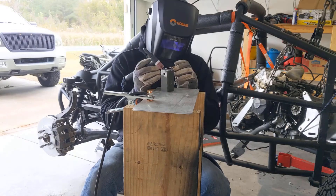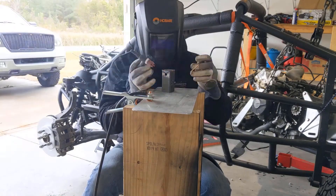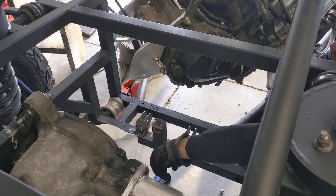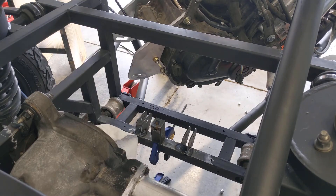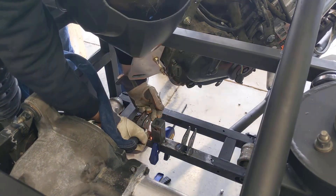While we've got the engine a little bit out of the way, one of the other things we're also going to throw in here is this other piece of tubing with a hole through it — that's going to serve as the mount for our jacker bolt. The point of this is to take all of the slack out of our chain to properly tension it by sliding the mower either forwards or backwards.